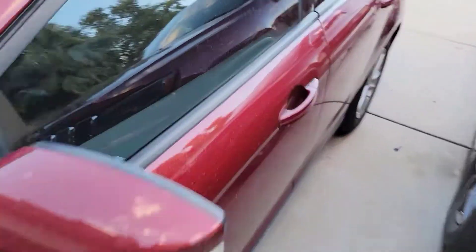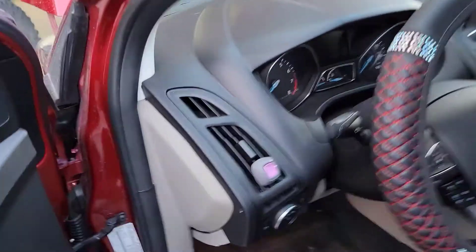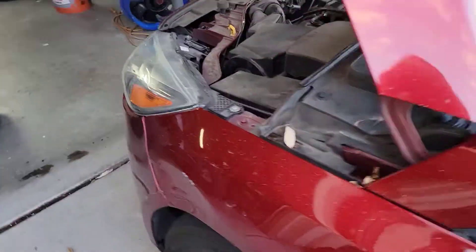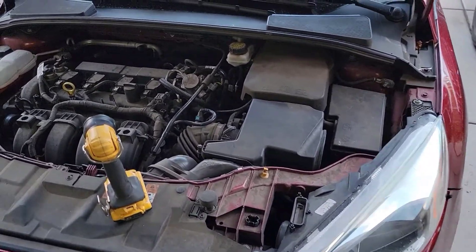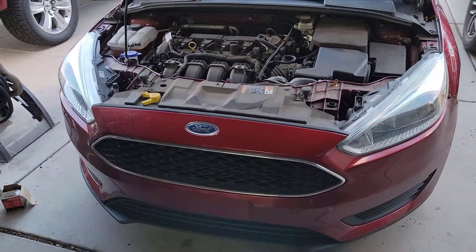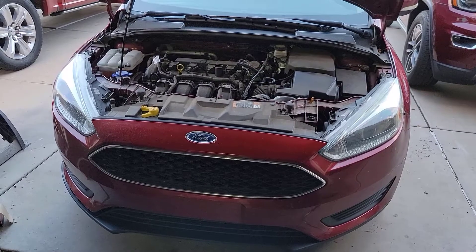And evidently from looking on the internet it's very common. She said when she did contact Ford at 55,000 miles, they said, 'Oh yeah, that shudder's actually common.' So now that I know that it is a DCT and not an automatic, I'm not as worried about it breaking down. It'll probably just go forever like this until you get sick of it. But if it was an automatic slush box doing what I felt, I thought it was like the torque converter or torque converter solenoid sticking, causing the shudder — and that's definitely something you don't always want to let go for too long.